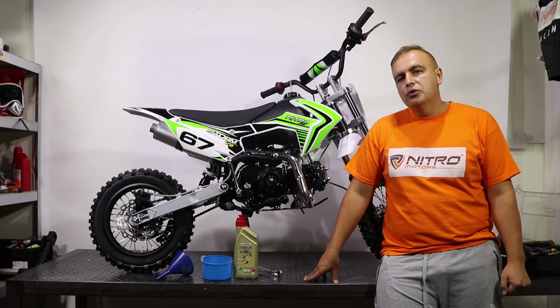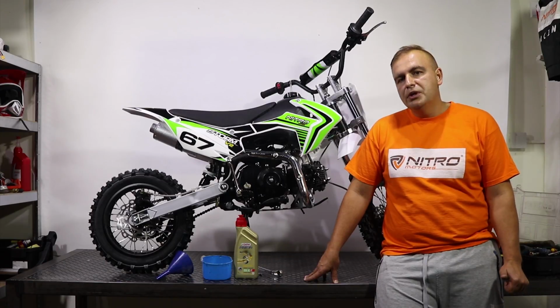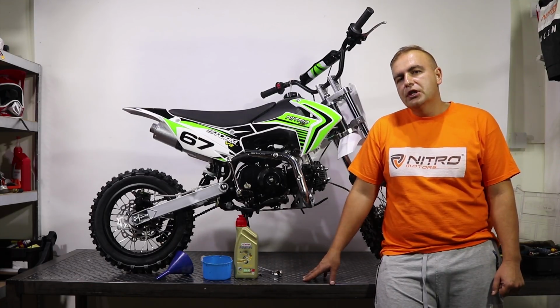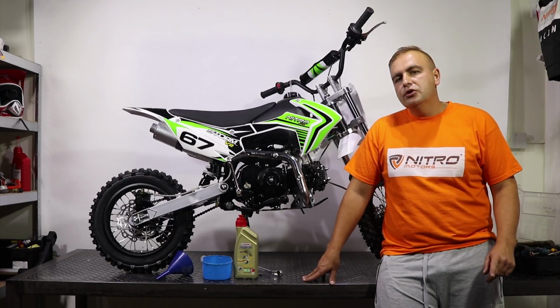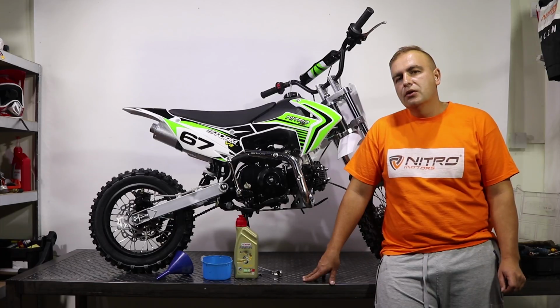In this video I'm gonna show you how to replace oil in pit bikes. When you get a brand new pit bike, you should replace the oil straight away before you start the bike for the first time. And then every 3 to 5 months you should replace the oil.